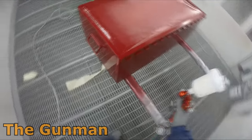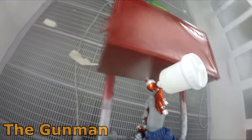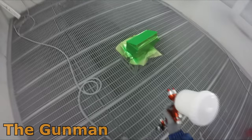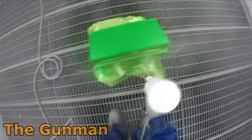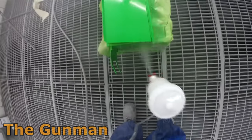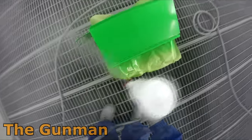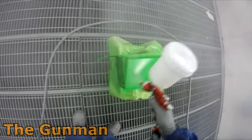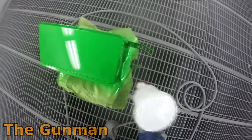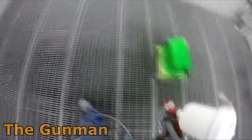So originally when I was painting these parts, I hadn't actually seen that video. So 50 PSI with full fan, which is what I'm used to, was totally ludicrous and just not going to happen. So I did end up trying his recommended settings, but it was still over atomizing. You had to move so fast and you really couldn't see what's going on the panel. I had to hold the gun so far back so that I had an open enough fan that you're actually hitting enough area as well. And I ended up just saying, no, it's just not really the right way to spray.